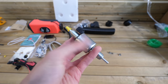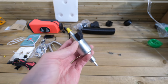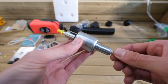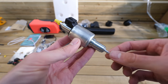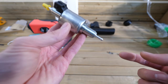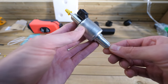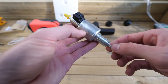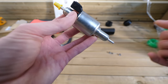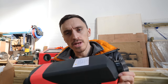Each time the pump clicks it moves exactly 0.02 of a milliliter — the same amount every single time, which is why when you ramp up the heat it clicks faster. I'd definitely recommend pre-priming the tube all the way from the fuel tank to just before the filter, or even filling the filter with a bit of diesel if you can. Every click without fuel is running dry and very slightly wearing the pump down, so pre-priming up to or into the filter will help get diesel in quicker, lubricate it, and extend the pump's lifetime.